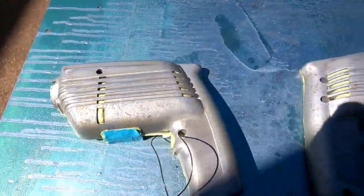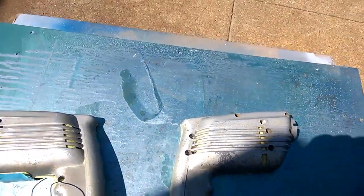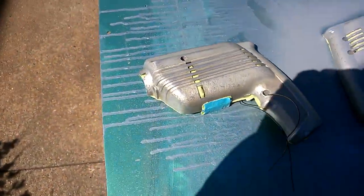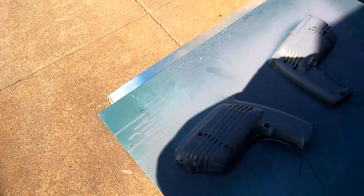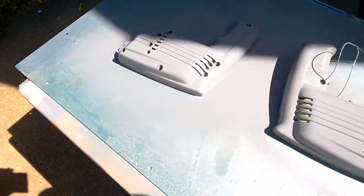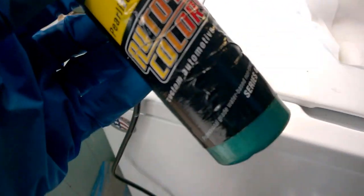Now to prime it up. We cleaned everything off, washed it down with mineral spirits, got all the sanding dust off. I'm using a 2K primer from either Summit Racing or Eastwood — about thirty dollars per quart, which sounds a little pricey, but a little bit goes a long way. I used a detail gun so not much material was used. Going with light strokes here so there's no risk of paint drips or runs — a couple of coats and we're set. We'll let it dry for a day, then paint it.